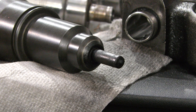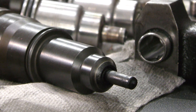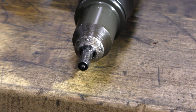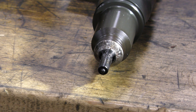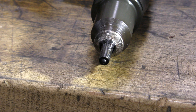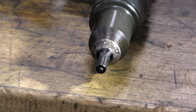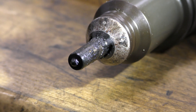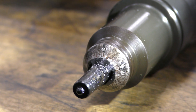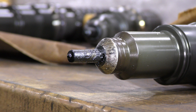Take a look at the tapered section on the tip of this injector. You can see a thin silver band. Notice how the silver band completely contains all of the carbon deposits on the tip of the injector. Now take a look at this injector — I pulled these out of a truck that was having some issues making power. You can see the tapered section on the tip of the injector is completely pitted. It also looks to be shiny, and it has a slightly more rounded appearance than the ones that we pulled out of our engine.